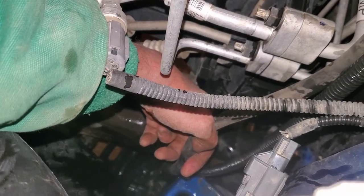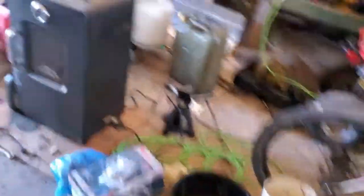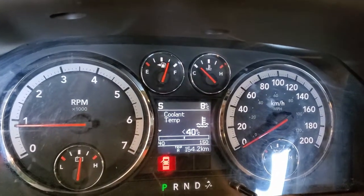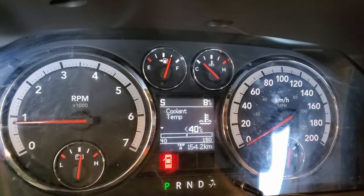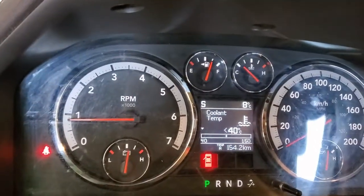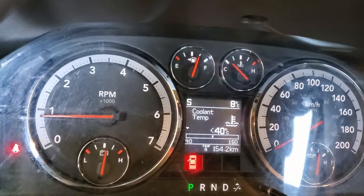We got coolant in. Just going to run it for a bit — we're going to try to burp it. So I've got my 50/50 blend. Now when you're doing this, what you're going to want to watch out for is your temperature. Make sure it's not going to spike. If all of a sudden you see she just gets hot and hot and hot, that means it's just an air bubble. You've got a few things you can do — it'll eventually kind of work its way out. You can squeeze the top rad hose to try to pop that out.